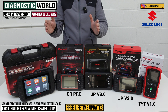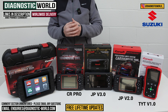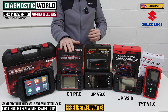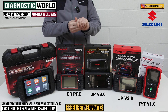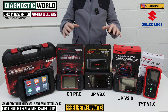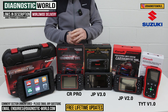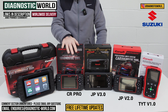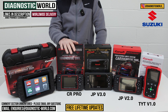The CR Pro is a good tool because it has a wide range of coverage for manufacturers. So if you've got a Suzuki but also a BMW, Mercedes, Land Rover, Ford, or Volvo, this tool caters for a wide range of manufacturers. It matches the service functionality of the version 2.0 tools — so it'll do your DPF regenerations, new battery registrations, injector coding, and things like that, but for a wider range of vehicles. Email us with your VIN number if you'd like to confirm which service functions work on your vehicle.